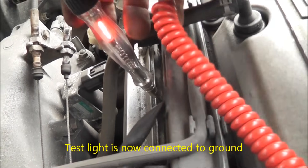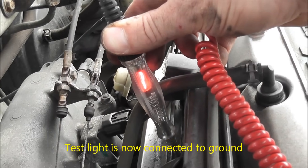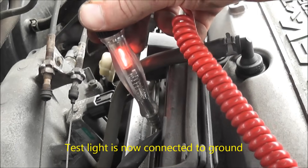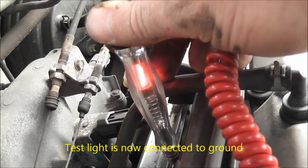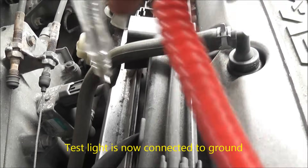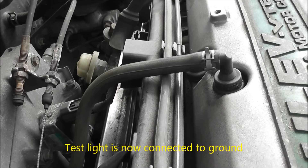Going to the control wire — I'll partially energize this injector, which isn't ideal. Crank it. There's a slight flicker in that signal. Two different methods both showing injection pulse is present.